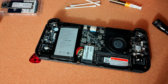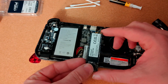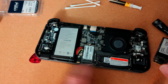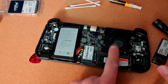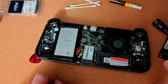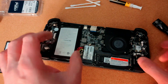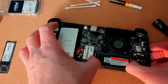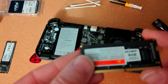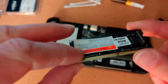So we're inside. There's a short SSD in there - I'm going to use a big long one because it just fits inside the case. You'll notice that little rubbery bit next to the USB - that's going to come into play shortly. First thing, let's take out this 8GB stick of RAM. We're going to change it with a 16GB green one.